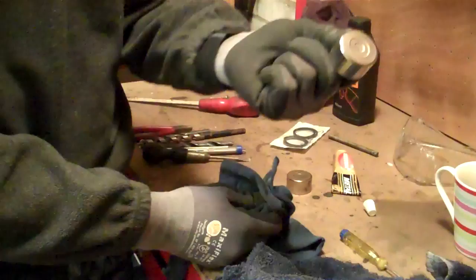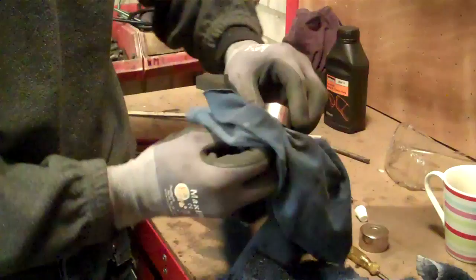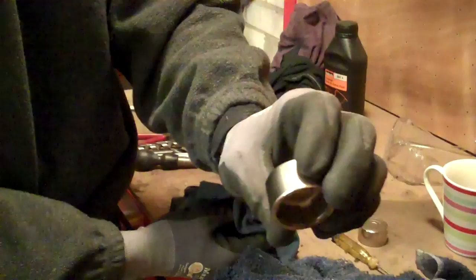Then you can inspect them for little nicks and cuts that are going to contact the seals. As you can see, they're perfect. That would have been £70 for two of them — £35 a piece. So just polish them. Very rarely do the pistons ever need anything more than polishing. They've really got to be bad to need replacing. People replace them because they're lazy or concerned. The word is polish, not scuff up. Because they are mirror polished when they're new — and that was just scuzz, crap and rubbish, road salt mixed with melted rubber and old brake fluid. Use a soft cloth, hard surface underneath it, and buff them until they glow.